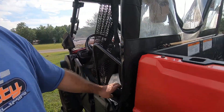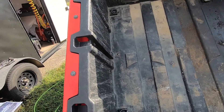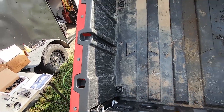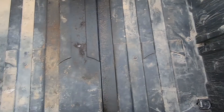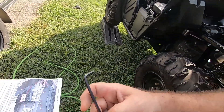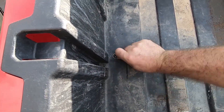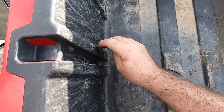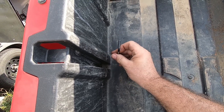First thing you're going to want to do is pop the tailgate up, and then here in the bed you're going to remove this screw in the middle — one on each side. You're going to want to remove those with a five millimeter Allen wrench, and what you're going to end up doing is putting a longer bolt down through those.